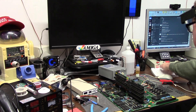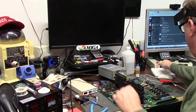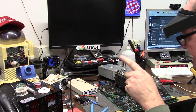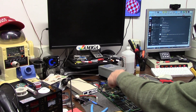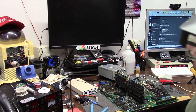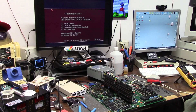Now there's also an issue with static column versus page RAM — the Amiga 3000 will not boot properly, or will not work at all, with the wrong RAM installed. I need to use the right type for the first four megs of RAM right here. Let's just turn it on — let me put Amiga Test Kit in the drive and go. No SCSI, no internal floppy — takes a second to figure out that it wants to boot, no battery to remember the SCSI settings. So four megs — one, two, three, four — two megs of chip.